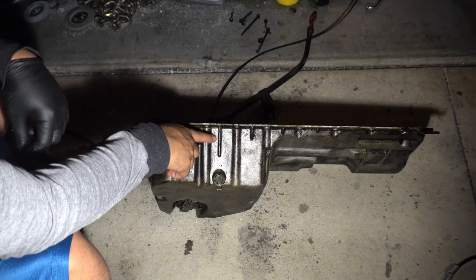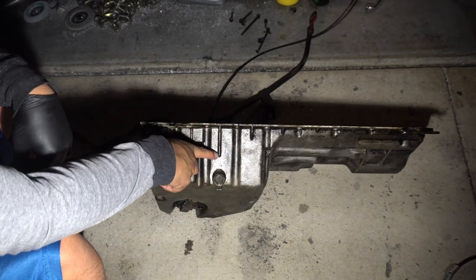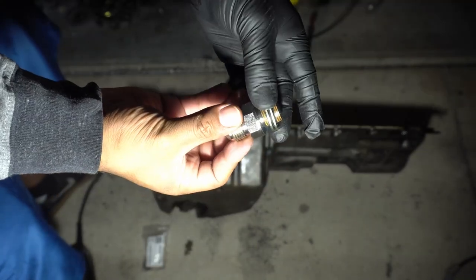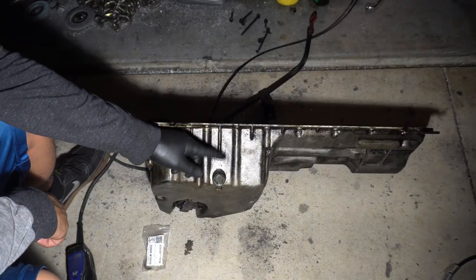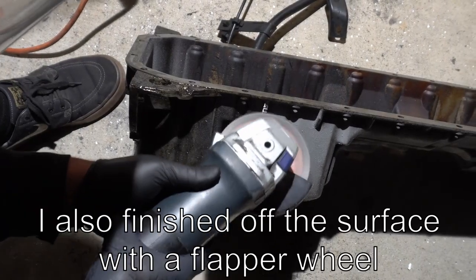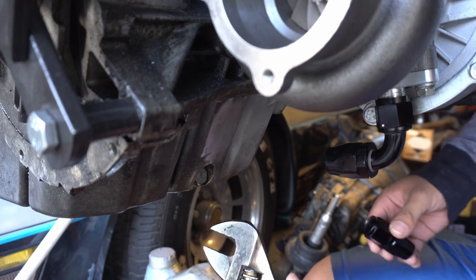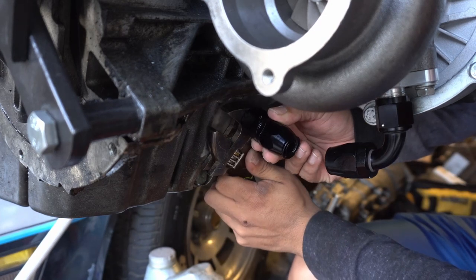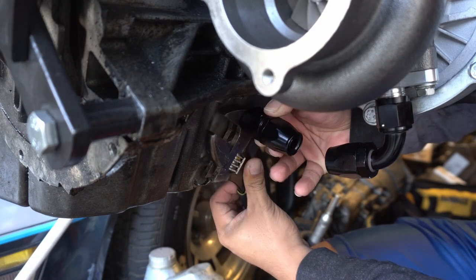So as mentioned I have to grind down this little lip here so I can have a full flat surface to put my bung. I do have to be careful — if I don't get this pretty flat I'm going to have trouble sealing that bung. In this setup I would have two washers, one on either side, to seal it off. I actually changed my mind about where I'm going to put my oil return bung, because using this adapter as a spacer puts the AN fitting at a really awkward angle to connect the AN hose.